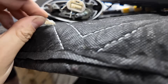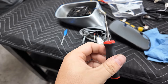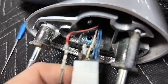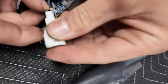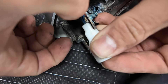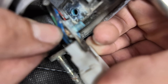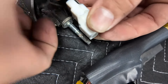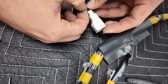It's almost like a Deutsch connector where it sits like this. You can see the little ridges - ridges stay down, so it came out like this. That's how it will push back in. You need to get a depin tool - I got this from Jose Valia Kaizen. Stick it up in there and depin it. There are two blue wires - one looks like it has a silver stripe, the other one doesn't. The second one has gray stripes on it. What I might do is put a piece of tape around one of them or put a red marker on it to mark it somehow.